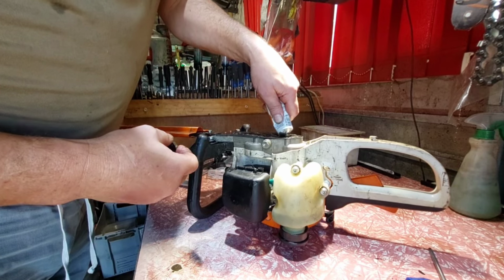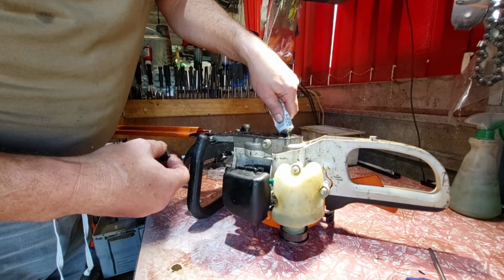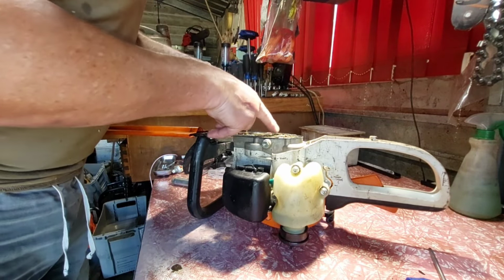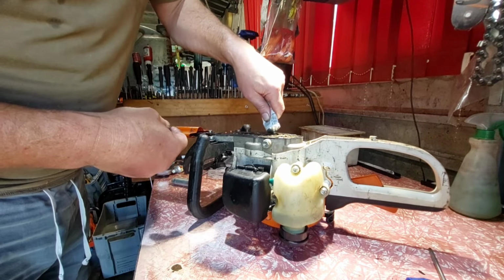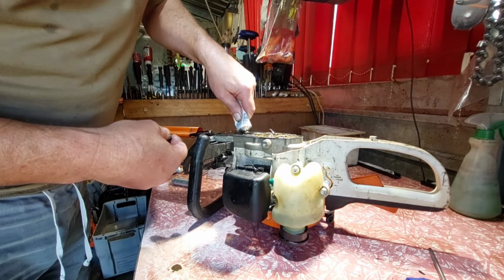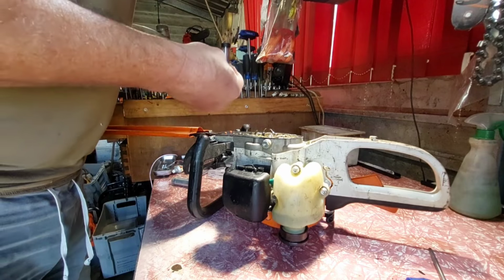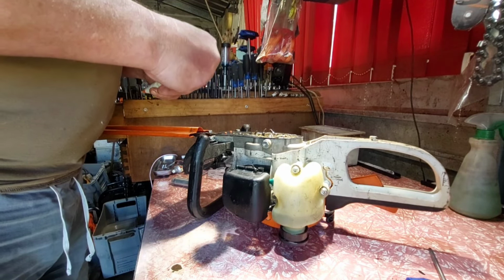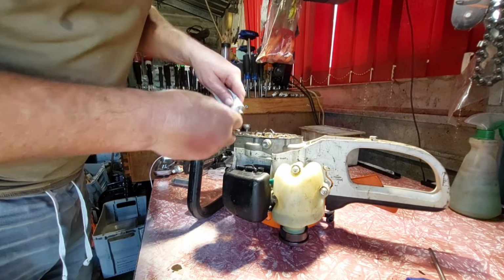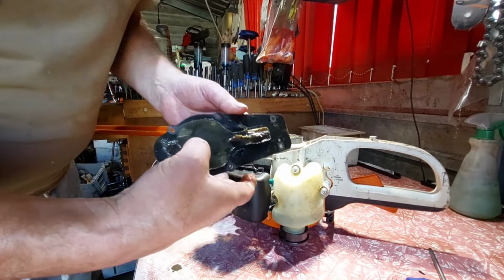Not everyone knows how to service this stuff, or has been taught, or I've just mucked around. I've worked out over the years what works and what does not work. That will go around the main crown wheel, the small pinion wheel there. Grease that up. Grease in here, because it's like an oil pump in there. I'm not going berserk with grease, but I'm putting enough for it to be lubricated. We use these things for at least a couple of hours every time we use them. That should be enough. Put that back together. Didn't bust the gasket. I might wipe the old grease off the plate and put more there. I don't want that old grease mixing with the fresh grease if I can. It's a bit dead looking, okay? I'll wipe that off.